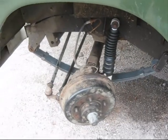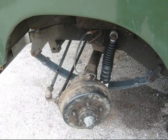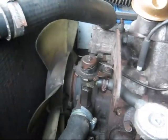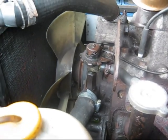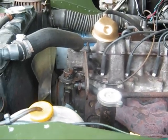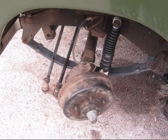Shockers on — I've just got to put a band around the bottom there. I'll jack it up now, put the wheels on, and go for a little spin after washing my hands and cleaning my trousers — I don't want to sit on my nice clean seats. I have got a water leak so I can't go far; the heater control valve I've ordered should be here tomorrow or the next day. I've still got the wiring to do and a few other little jobs. There'll be front wheel balancing as well — just to recheck them. A little bit of wobble at 50-55 mph.